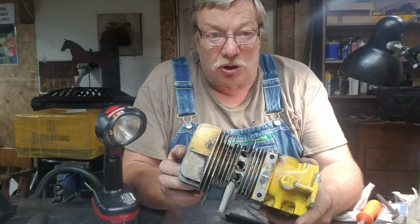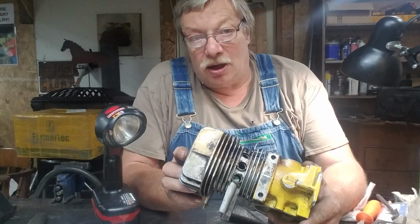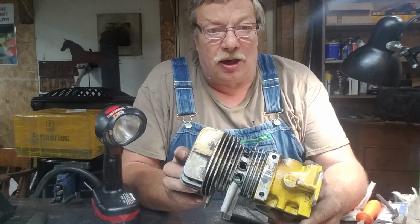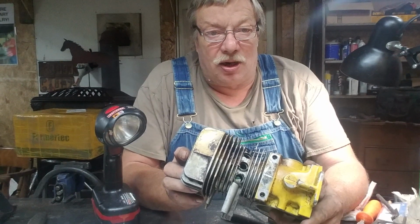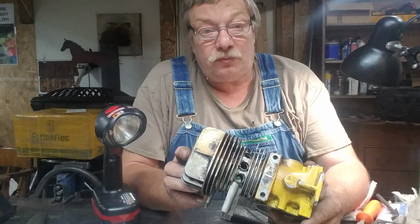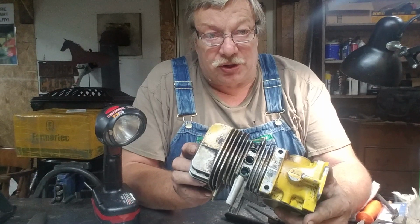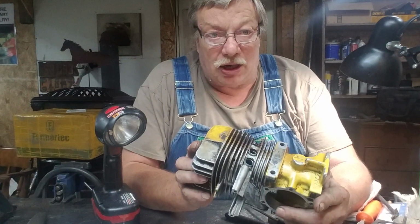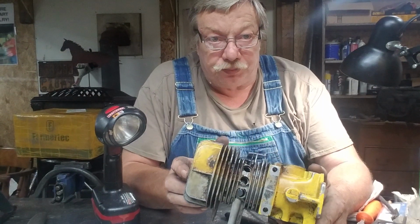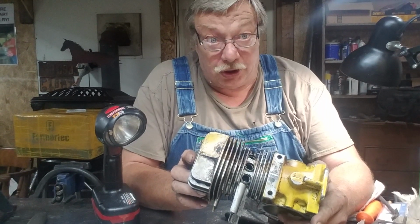Okay, now the reason I knocked them plugs out is because I can get in there and alter my transfer timing. I need to raise that to match the change that I made on my base gasket delete, plus the different deck height of the piston. I have to raise them. I'm not sharing numbers yet. I will tell you it's more modern saw numbers, which are really scary.